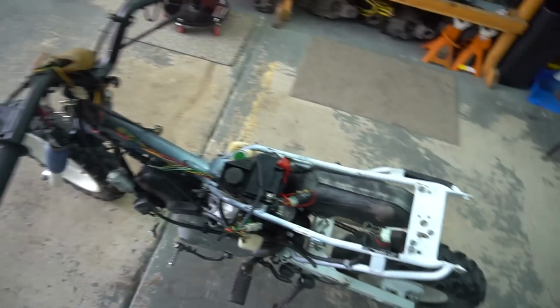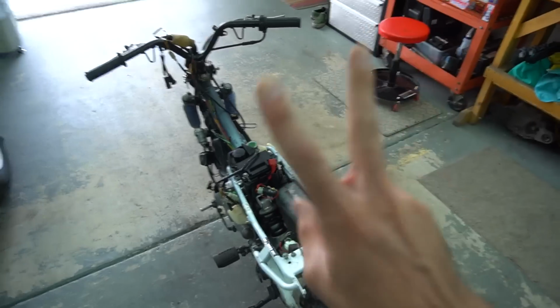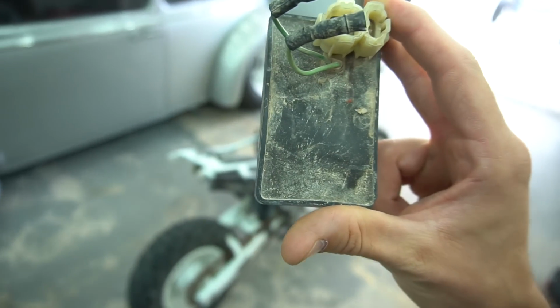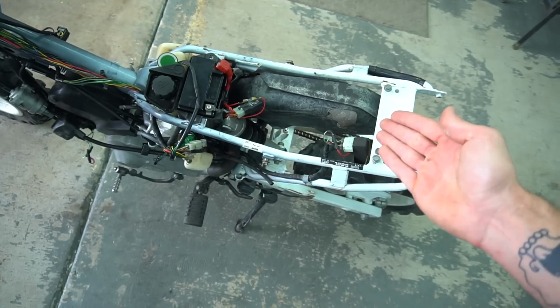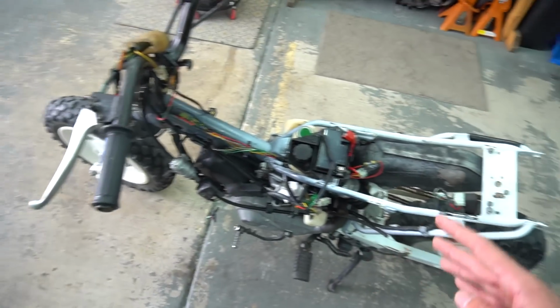Again, I went through to test the theory using the old CDIs that I had laying around from the previous bikes, and still, when I plugged in those CDI boxes, it had no spark. We had 2 issues here. The CDI boxes were bad, and the thing was looped. Like I said in the first video, the CDI boxes are a very common issue in these bikes. I don't know what it is, whether something in there just breaks circuit, it was a faulty design, not sure. But the CDI boxes is very common to be a problem in these EZ90. We did actually need the new CDI box, but this was the issue. I'm assuming the CDI box went bad on the old owner, and he thought it was something else.